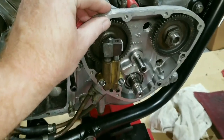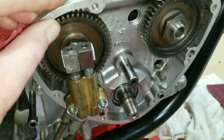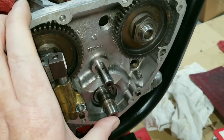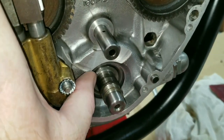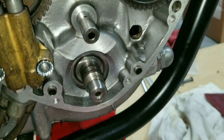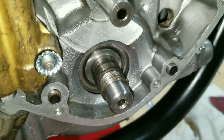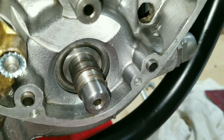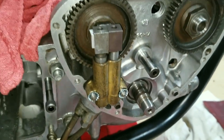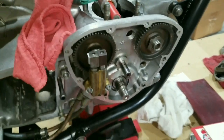Alright, we're getting ready to put the timing stuff in. We talked about how the timing is done and we're going to put the idler gear back in, but first we've got to put the pinion gear in. Before we do that, we need to oil this bearing down here really well so it has good lubrication for initial startup before oil starts circulating in the system. Then we'll attach the oil pump.